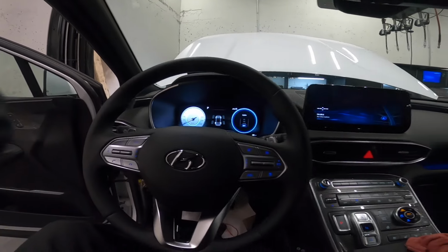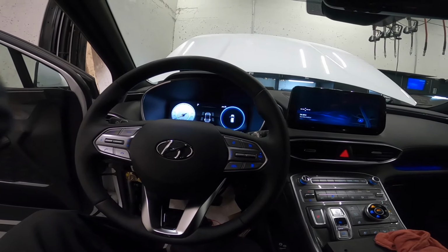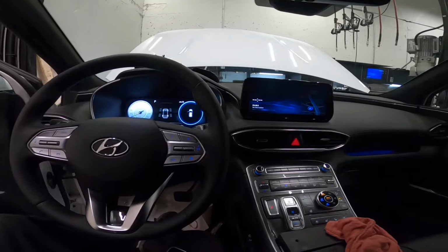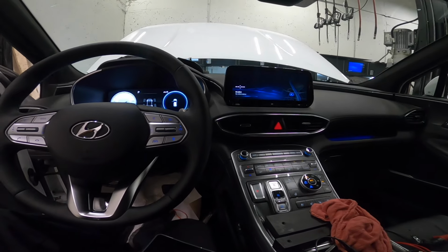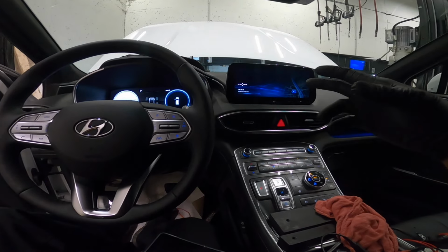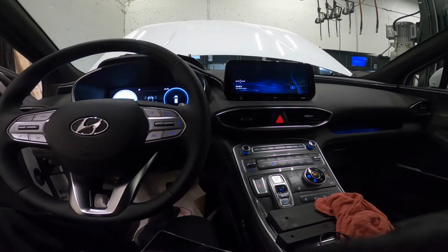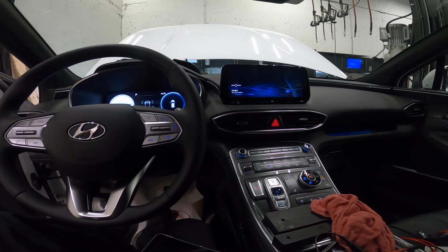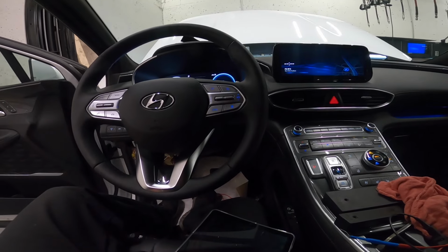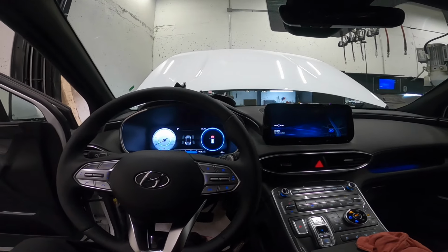So when we diagnosed that one, we just followed, for me, the easiest access on the circuit. And the determining factor is when we went to our hazard switch and thought that there could be a short on that wire that sends signal ground to the smart junction box. But when we measured it, we checked it, there's no short to ground on that pink wire. So that's why we ended up saying that it's the junction box that's got something inside turning it on by itself. So yeah, I hope you guys enjoyed that diagnostic.